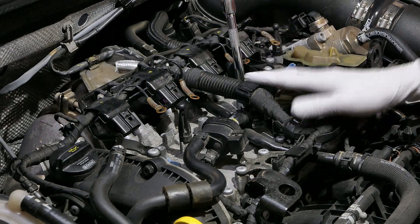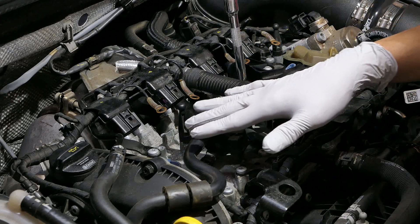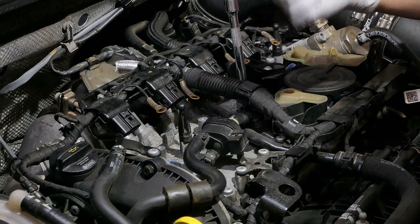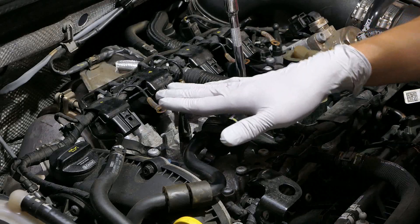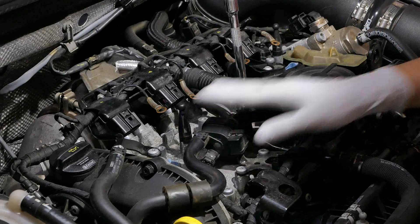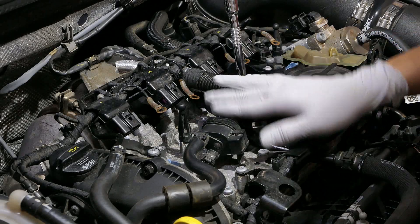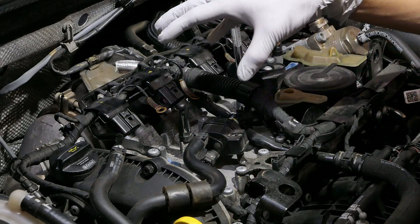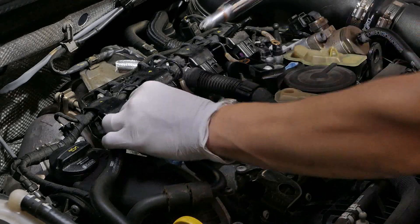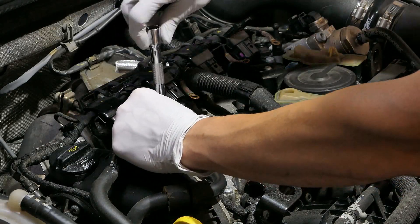After about 30 additional minutes of working on cylinder 3, I was able to remove it completely. I ran some compressed air through the holes to make sure there was no debris, and while they were open I plugged them with clean shop rags so nothing could fall into the cylinder. Now we'll replace all of the plugs with the new RS7 plugs, torque them down to 30 newton-meters, and install the coil packs. Always hand-tighten the plugs first until snug before you start torquing them down.